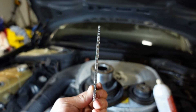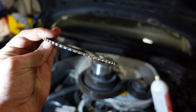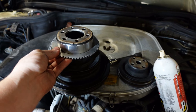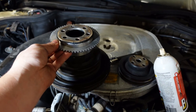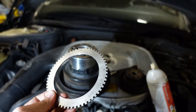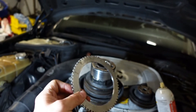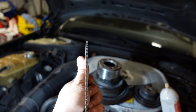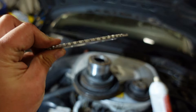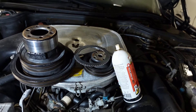I may have to make or buy another one of these and bore it out, because we were trying to do a press fit, but when we were trying to press it, this thing kind of bent over. I flattened it some with a vise and hammer, but I'm not so sure — it still has some warp to it, so I might have to work on that some more or end up buying a new one.